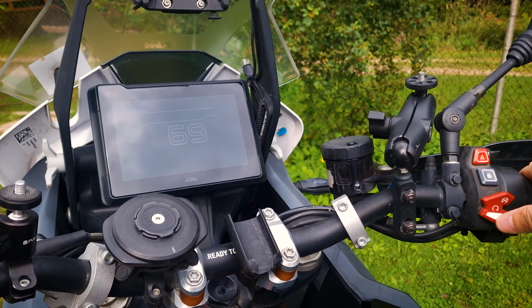So I decided to connect the pressure gauge and see how much pressure it was giving. To do this, I just had to turn on the ignition on the bike. Only I didn't take into account that the pump, if it pressurizes without dumping fuel, gives a pressure of more than 5 bar. Of course, my pressure gauge went off the scale. But that's good, it means pressure is there, and there's no problem with the fuel supply. That's both good and bad. I was hoping it would be easy.